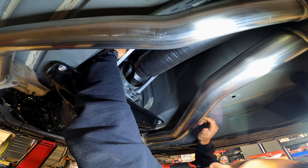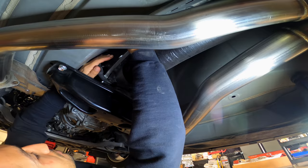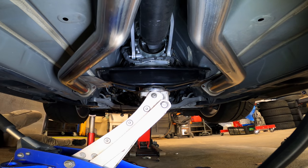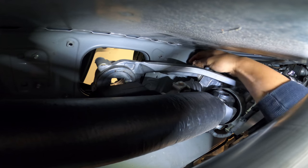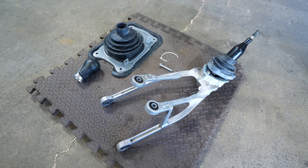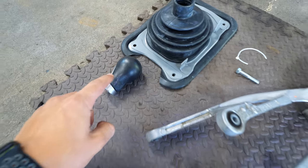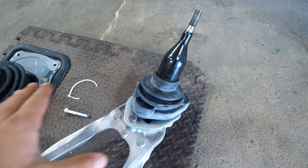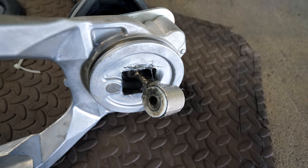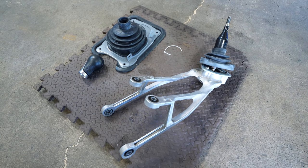By lowering the brace, it will give us more room above the transmission to remove the hardware securing the four-link shifter support. There will be two bolts found on both sides and another two on top. Without lowering the brace and transmission, the two side bolts will be easy to remove, but the two upper ones will be pretty much impossible. With a jack supporting the weight of the transmission, fully remove the four bolts holding the transmission brace, then lower the jack about an inch. With all four bolts for the shifter support removed, finagle it around the drive shaft and past your Y-pipe. The only OEM part we're actually reusing is the lower bolt — clean it up because it'll be covered in grease and you don't want silicone or debris on the threads when you re-tighten it to the shifter linkage.